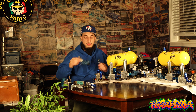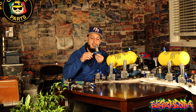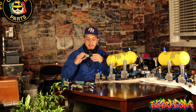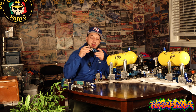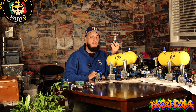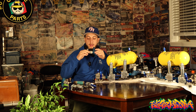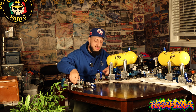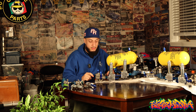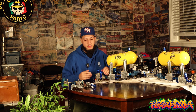We go through this to the slowdown. Slowdowns are Republic — Republic Appliances is actually a subsidiary of what was Parker at the time. There are a couple different types of Republic slowdowns. We call them slowdowns because they slow down the fluid flow, but they're actually called needle valves. So when you're looking for them outside the lowrider world, call them needle valves.